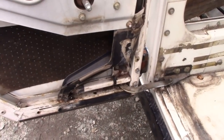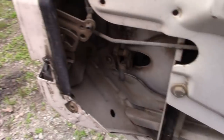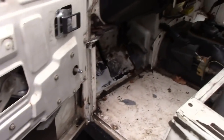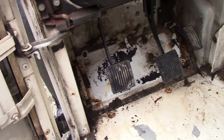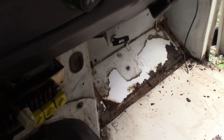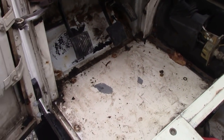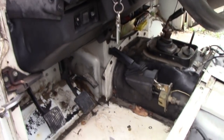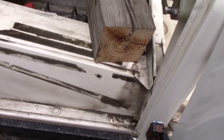They've done that both sides. Let's have a look at the terrible footwells. Oh and look at those terrible doors there — aren't they awful. The footwell's got a little bit of corrosion just in that top corner. This one's come out a little bit worse, it's got a few little spots on it. I might be tempted to take the floor pans out and re-bolt and reseal it all again. It's worth it isn't it, because somebody's painted over all the bolt heads.